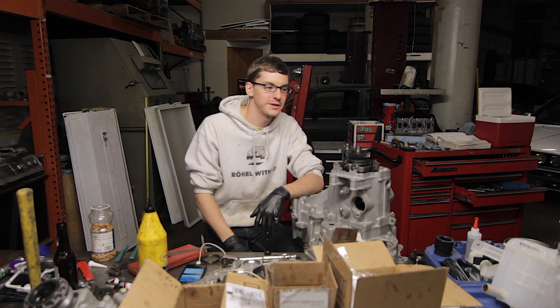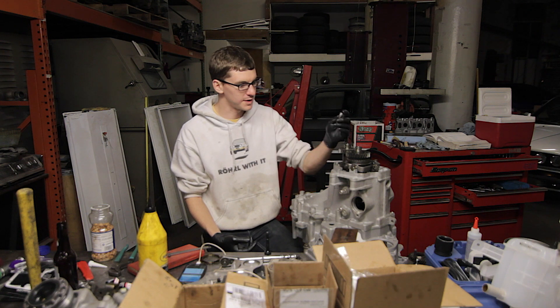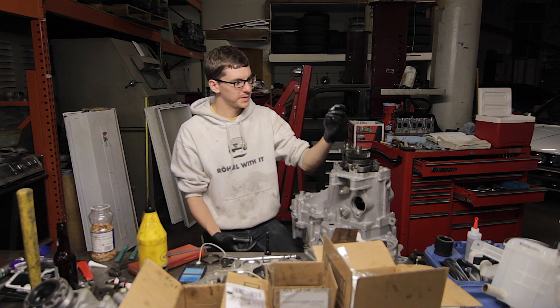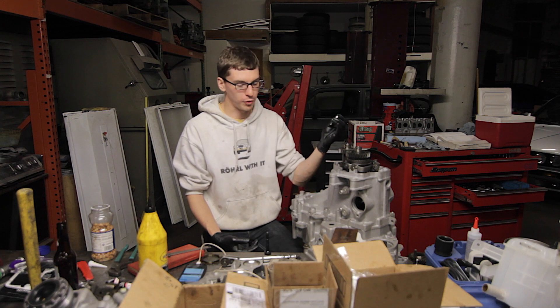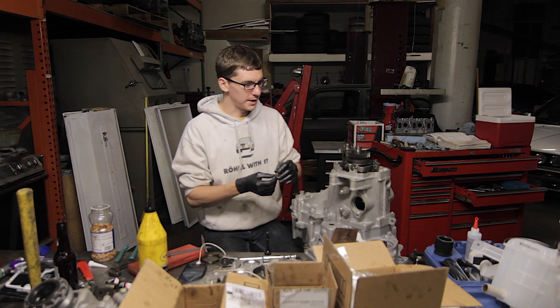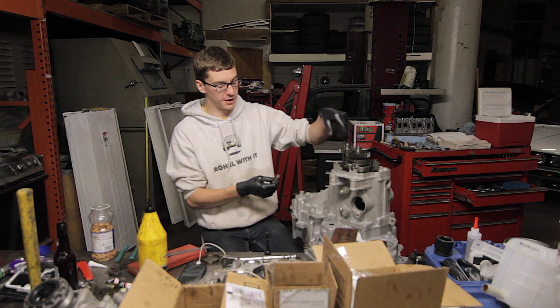So, once again with Kendall's help, six weeks later, we finally have everything we need and the transmission is about 95% of the way together now. The impasse for this evening is a special bolt — I have the example of the main shaft bolt which holds fifth and sixth gear on the end. But there's a longer bolt, a special part that I should have had, that goes through the countershaft fifth and sixth gear, which are the fixed piece where they're all together.